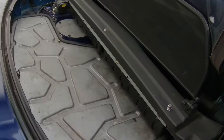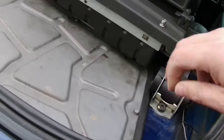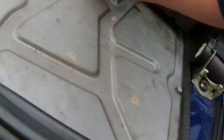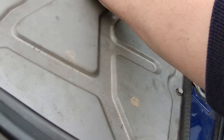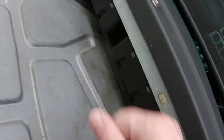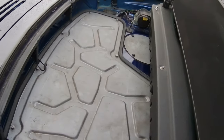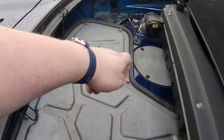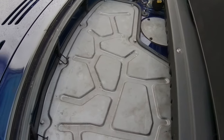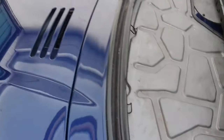And there we go. That's the cover and insulation out. It's all one piece. But you can see the clearance under here is absolutely dreadful. And somebody hasn't put a bolt back in there after the cam belt. Hopefully that'll be in the center console. Anyway, I think there's 11 on there. 1, 2, 3, 4, 5, 6, 7, 8, 9, 10, 11, but there's only 10, so I'll get these out. Should be 10 mil nuts. Get that out, then we can access the engine bay